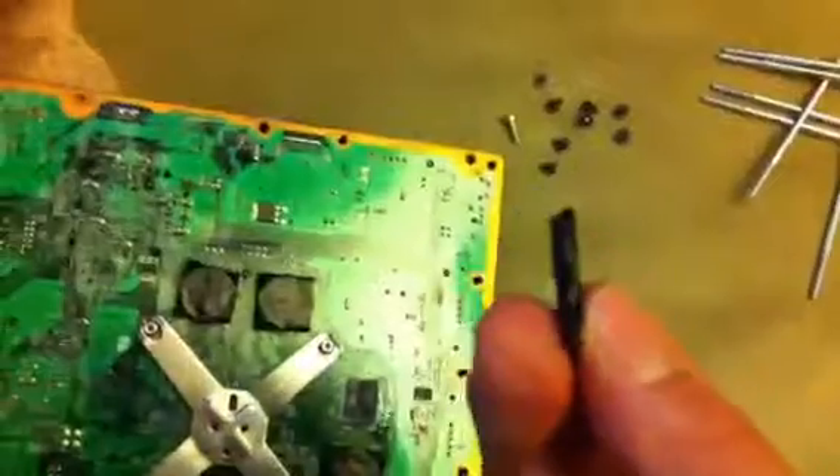The penny trick - you take two pennies. Some people don't get it. You take two pennies like that, you wrap them one way around it and then the other way around it. And of course you have to pinch all the corners so no part of the penny is showing. These were stuck. This is what it looks like - it's a little chip. This is what was stuck on it, and the pennies with the electrical tape are what you're replacing.